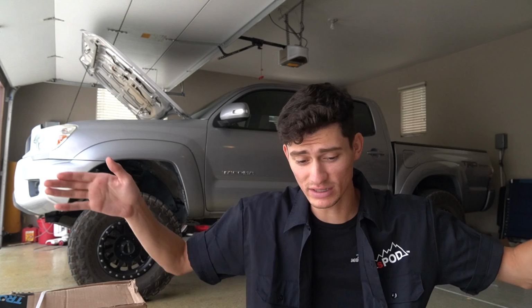So essentially, I'm replacing everything between the 2 front tires that has to do with steering or can affect the steering or misalign something, because one, I've had a problem with my steering wheel completely going off and getting stuck at like a 45-degree angle. 2, I've had a problem with the toe alignment on my passenger kicking out every time I get it aligned and I take it off-roading. 3, there's like a god-awful squeaking, like high-pitched screeching noise coming from the steering whenever I turn now.